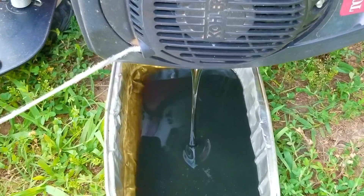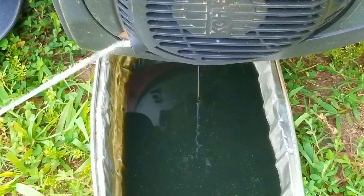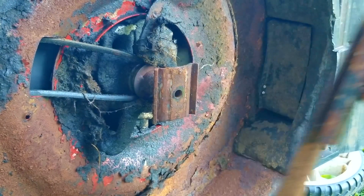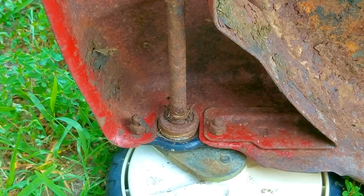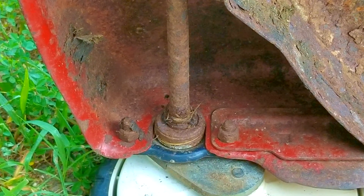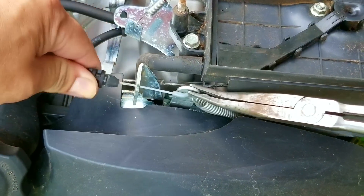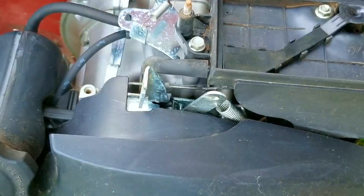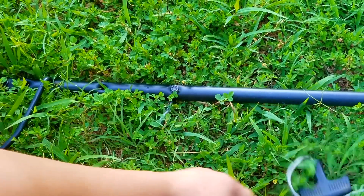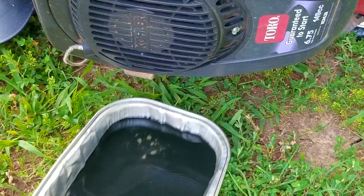I could have used fresh oil but with the price of everything going through the roof I simply didn't feel like it. Now with this mower on its side I'm also going to take off the blade — it's surprising just how much rust is under here. I have to wonder if this mower was partially submerged in water at some point. While I'm thinking about it I'm also going to disconnect the brake cable from the engine and the pull string from its guide on the handlebar. Once the oil is done draining I'll replace the dipstick so there's no chance of spilling any leftover oil.